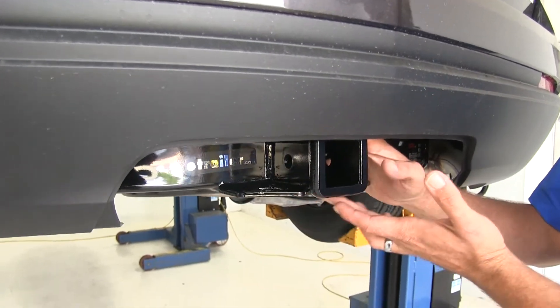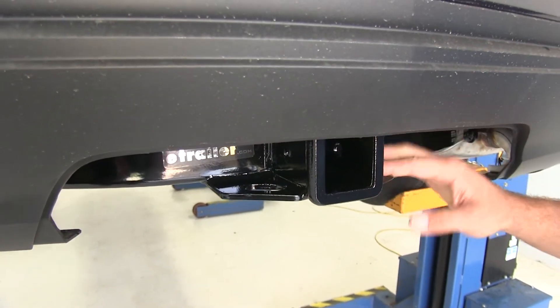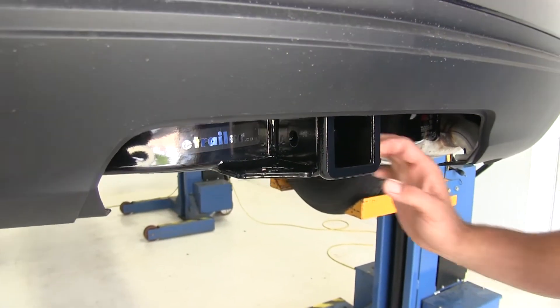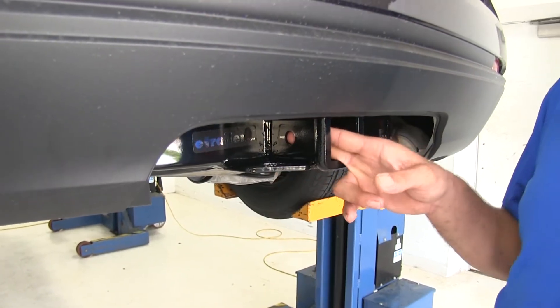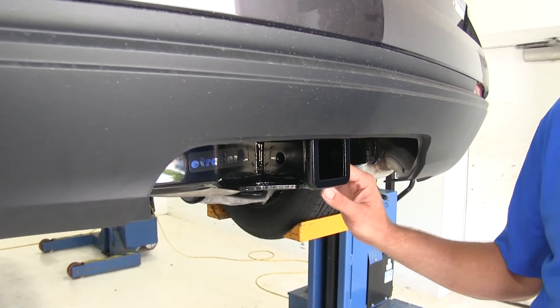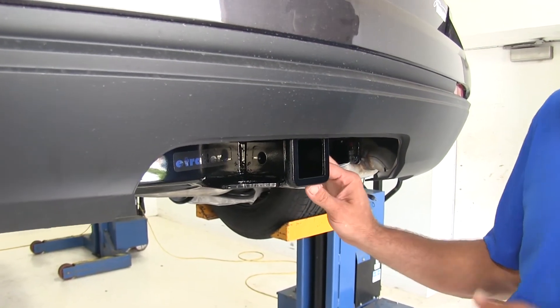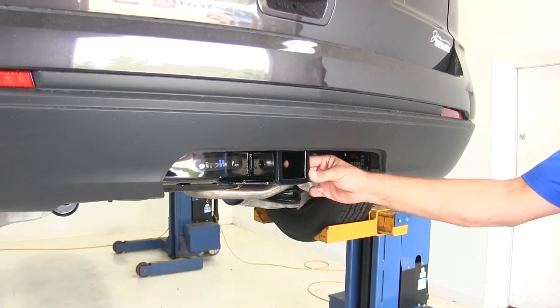This is going to have a plate-style safety chain connection point on it, with oval hole openings. There don't seem to be any issues with clearance, so you should be able to get all kinds of chains connected. You'll see our hitch pin hole — it's going to be 5/8 of an inch in diameter. We've got plenty of room around it for anti-rattle devices, locking hitch pins, pins and clips. Just be sure that those are rated for Class III use.